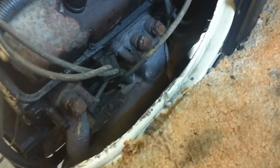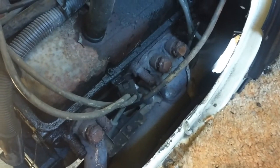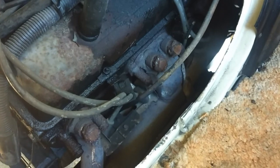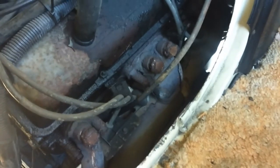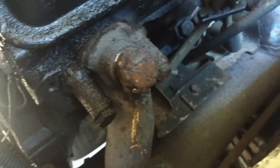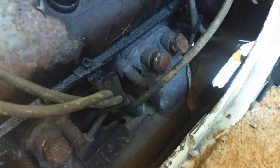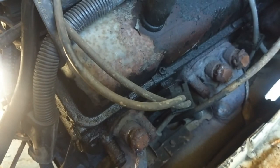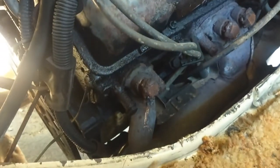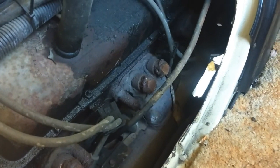But those tubes are very thin metal. After time, they rot out and they leak like crazy, so I did one side at a time, sort of did the best I could. Shoved some bolts in there, tapped them in, and then welded it right around. So it's pretty quiet, you know. There is a small little tick, and actually one of the flanges down there that hooks to the exhaust on that side is kind of all wonked up, so that's leaking too, but it's drivable, usable, you know.